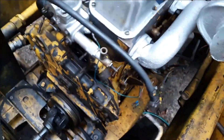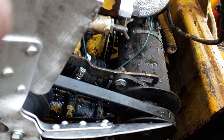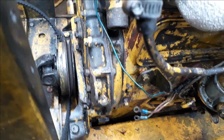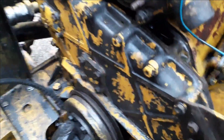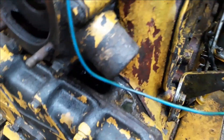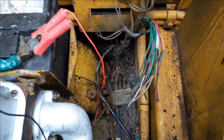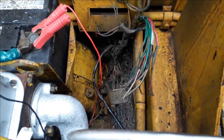As I said before, the machine wasn't charging, so I've taken off the old dynamo which fits onto those brackets. Not easy brackets to alter because they're not full brackets — two brackets just fastened front and a little bit further back on the engine. Also, the cables have been kind of cut away; there's no fuses, no fuse box at all — it's all just been removed.